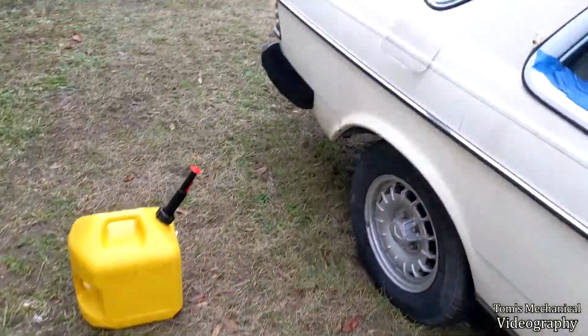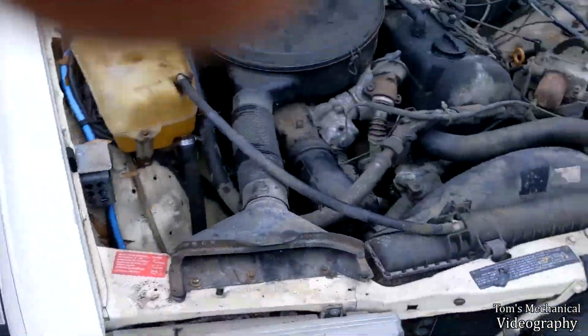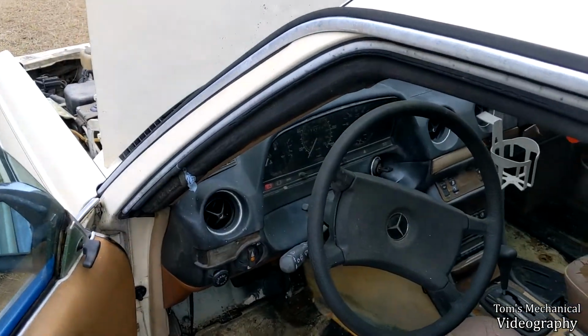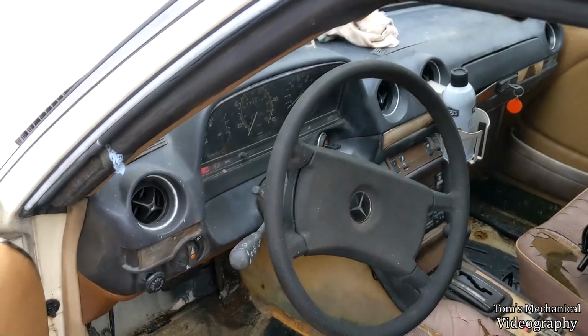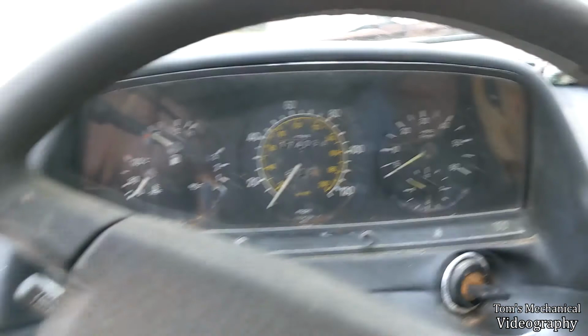So I'm gonna quit flapping my gums and start pouring some diesel and start firing this thing up. Start the glow plugs going. Get us a snort of ether. Just to be sure. And we're gonna give this glow plug 5 cycles. I did 6 last time and that seemed to work, so we're gonna give it 5 and then hope for the best. There's one. Let's start this long process of going. Alright, had 5 a couple seconds ago. Ether is sprayed, water is on the floor again. And we're gonna send it.